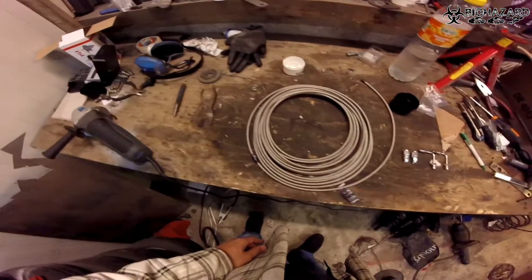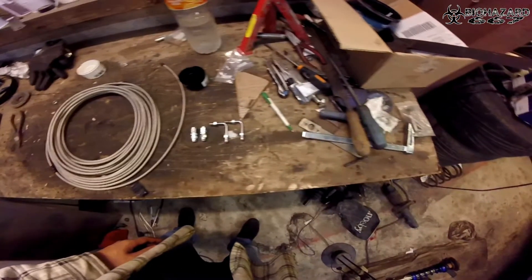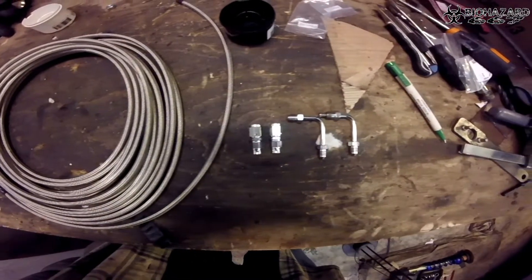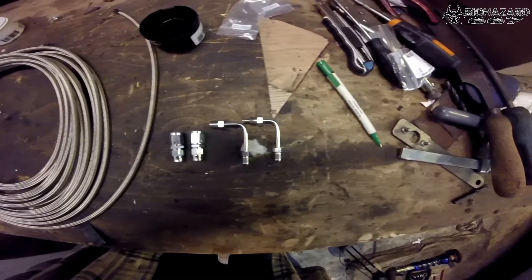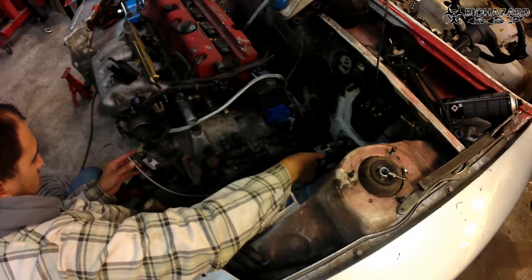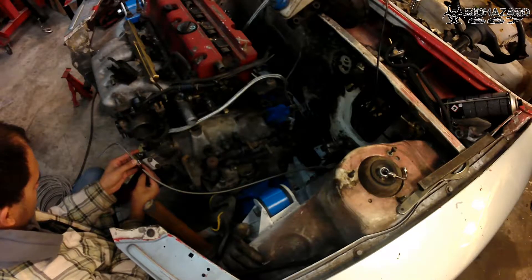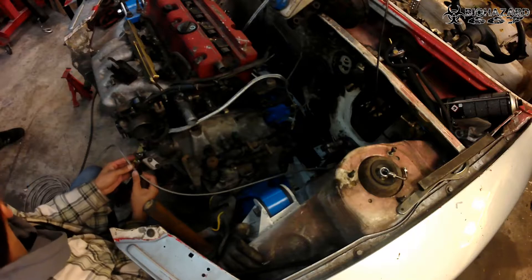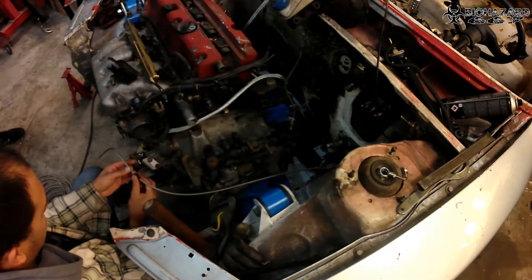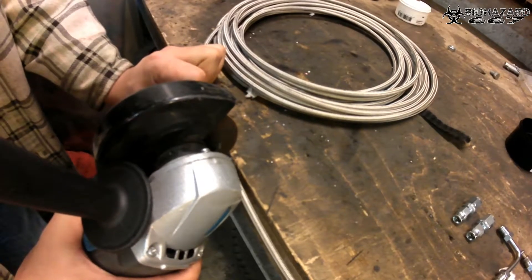At this point I'm going to need a clutch line. I've chosen to go for a custom flexible clutch line — I'm actually using just a brake line which will do the job just fine. These are the bits I'm going to use, I just got them online, so this stuff is widely available. Now I'm going to show you how you're supposed to be doing it. First you need to check out how long the line should be, then cut it with something like an angle grinder.